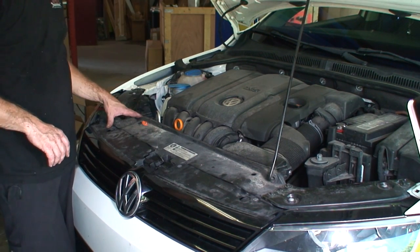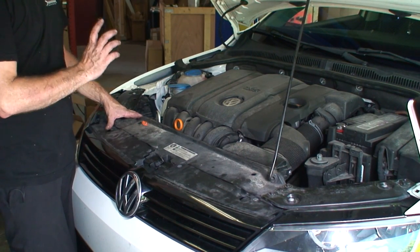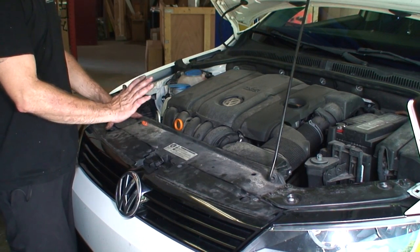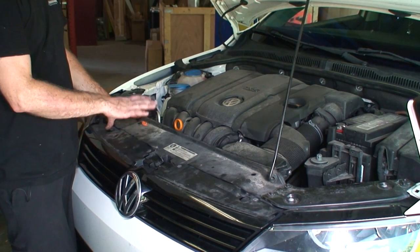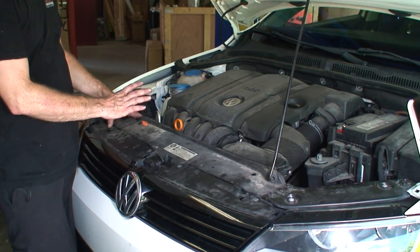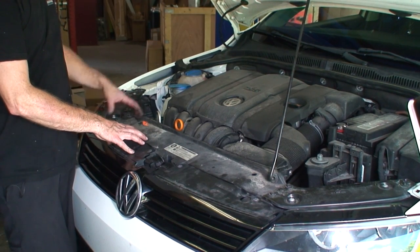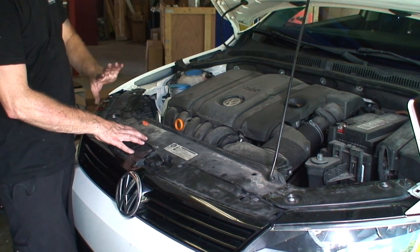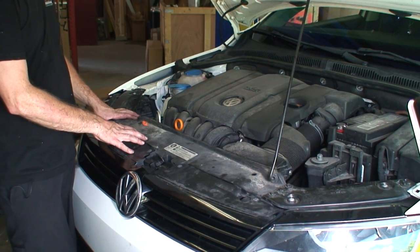So this is all pretty high-end stuff, vacuum compressor and the like. Once you've completed this step, now would be the time to take it to a shop and have it vacuumed down, and then have a certified tech handle the Freon and fill the system up. The charge specification will be stamped on the bottom side of the hood. But that would be for the tech that is going to charge your system.